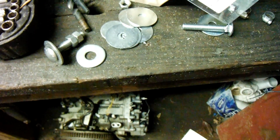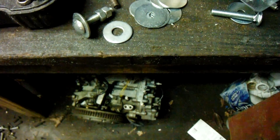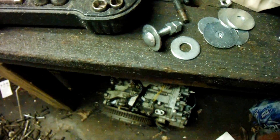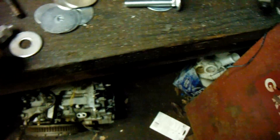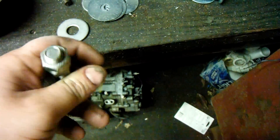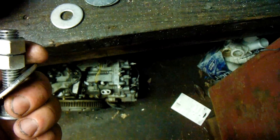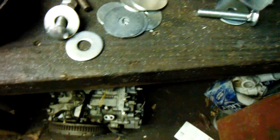Got the truck on the ground, filled it up with fluid and the friction modifier — used the XL3 friction modifier. I only used three quarts of 75W-140 full synth gear oil, so I'm assuming the 5.5 I found online was for pints instead of quarts. The tool is basically a 2.5 inch bolt with half-inch by 13 nuts and two 5/8 inch washers. I'll clean off the extra parts with brake parts cleaner and return them, same as the extra two quarts of fluid.